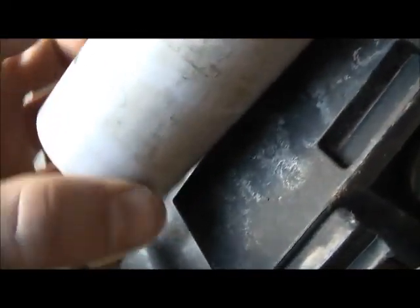So I have to pull that capacitor off — unplug, safety first. Let's go open circuit. I have written on it, because the printing was faded off: 450 volt, 25 microfarad, plus or minus 5% tolerance.